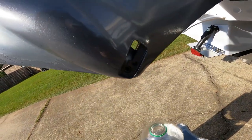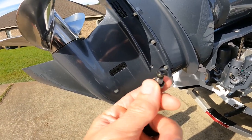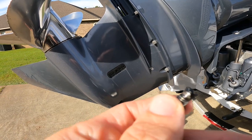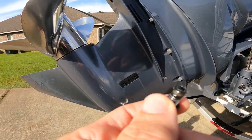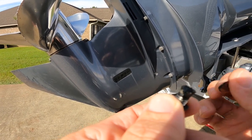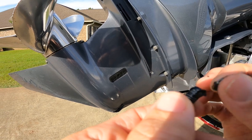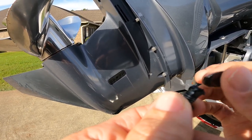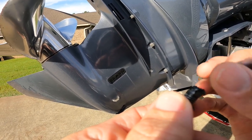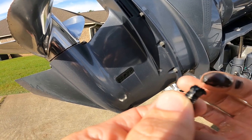I've just taken out the screw and you can see no oil is coming out yet because I haven't cracked the top one. One thing you'll notice when you take out the screw is some metal shavings. You want to feel that and make sure there are no big parts — it should be almost super fine. If you have big chunks of metal, you probably need to take it to a professional Yamaha dealership because you have some problems. But you can see that's really smooth — there's really nothing to worry about right there.